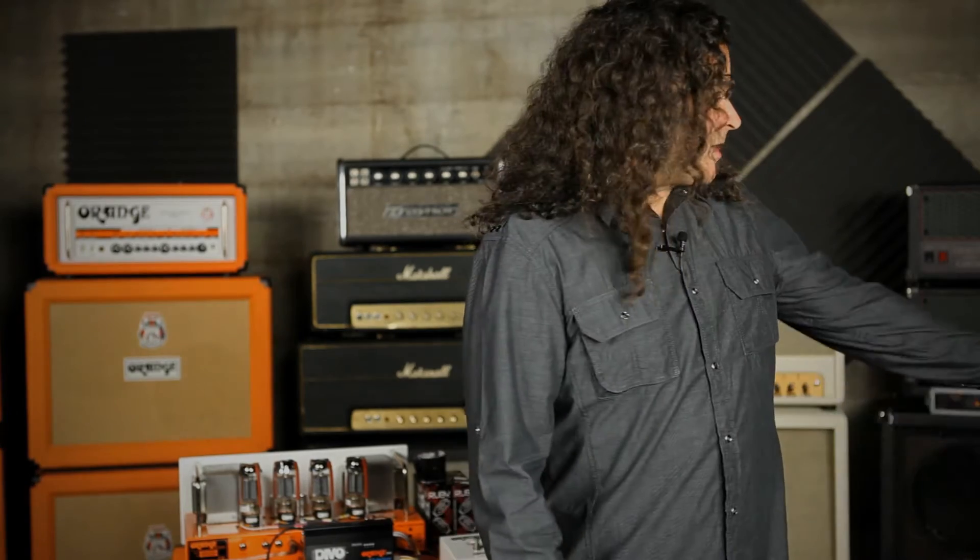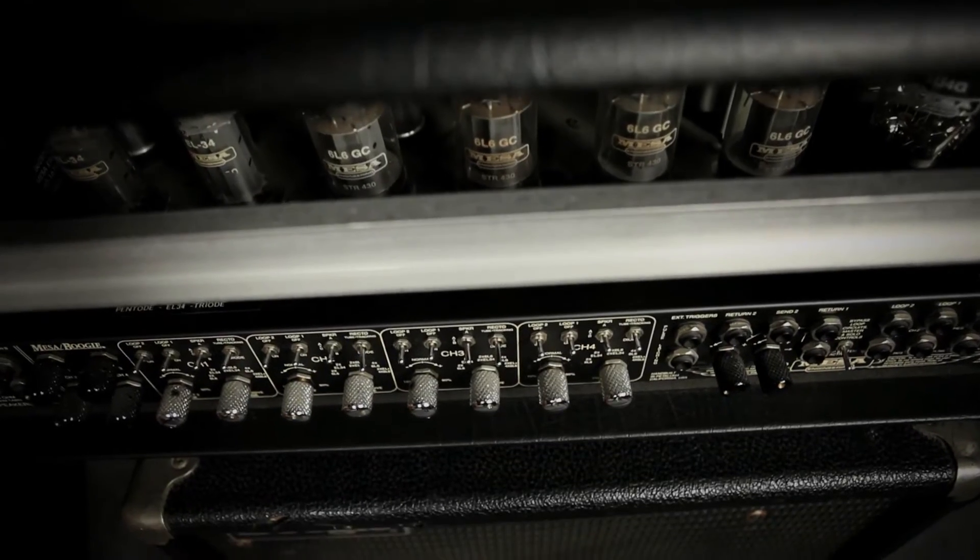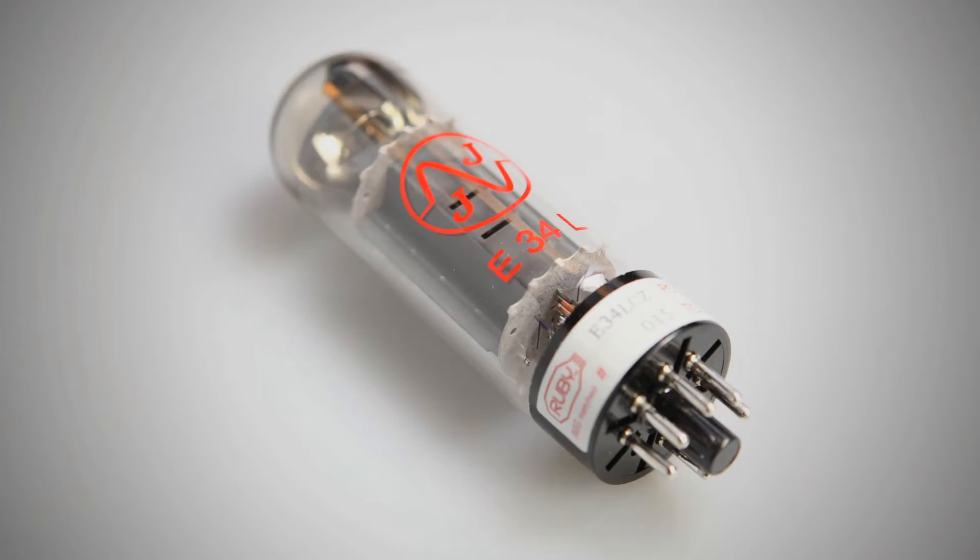The OV-4 offers unparalleled flexibility — some of the stuff that we used to depend on amp techs to provide, some stuff only available in super expensive amplifiers, and some stuff never before possible. For the first time, players like you and I can actually change out tubes, swap them, mix and match tubes like 6V-6s and EL-34s in the same amp, and the OV-4 will automatically re-bias them. It means you can try out lots of different tubes without having to fork over the big bucks for matched pairs or quads.